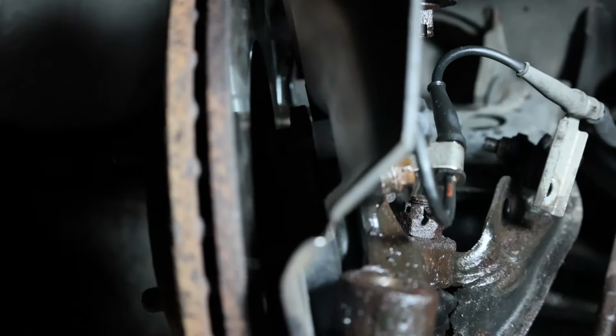But my plan here is to get those three off and put the lower assembly in, while the main problem is the black cable coming through that I'm not able to disconnect from the knuckle here. So if I were to take off both ball joints, the knuckle would just fall and drag that cable with it and strain it. So I can only remove one ball joint at a time. That's why I'm trying to replace the bottom one right now while the top one's holding on. Then I can replace the top one while the bottom one is holding everything together. So that's the plan.